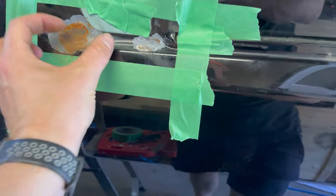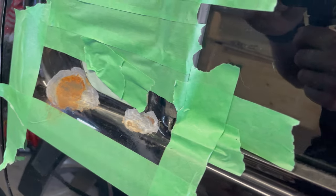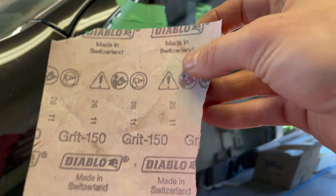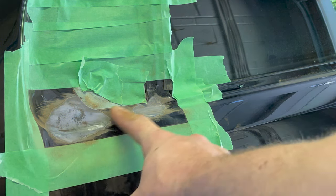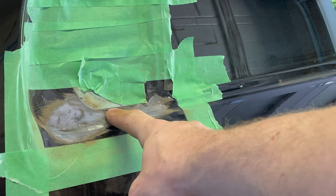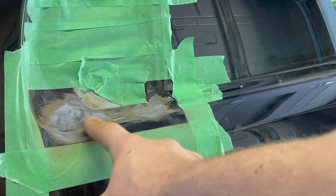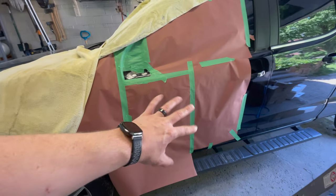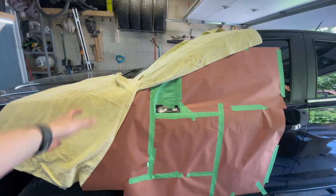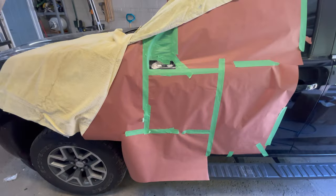Really not horrible — a little bit bigger than a golf ball but not great for a six-year-old truck. I started with 150 grit sandpaper by hand because I really don't want this to snowball. We're in a better spot now. There's no real pitting but I focused on the edges to make sure I'm down to an area with no corrosion underneath. It feels solid and I've worked the edges hard so I don't think there'll be any paint flaking up.